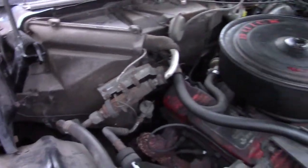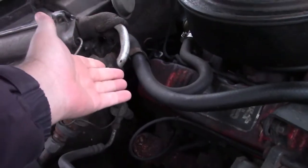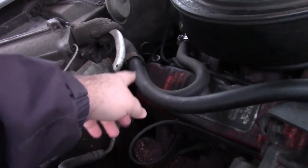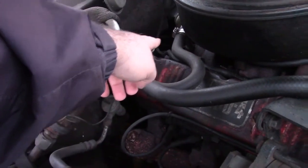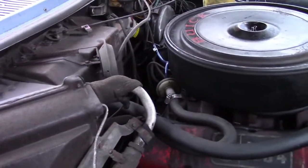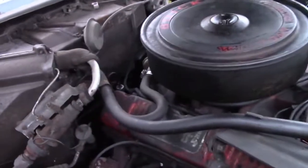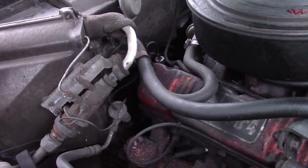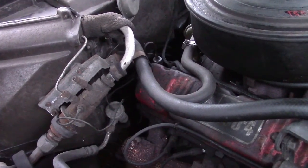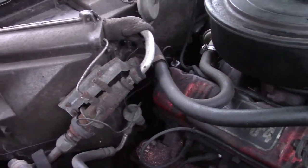to bring her in. Now, I could be cheap about it and bypass the heater core by taking these hoses off. I could actually take this one off and put it to the heater control valve, with my vacuum line using the surgical tubing, which is working great. And that would bypass it, and that way it wouldn't leak. But you know, there are some days in the winter where it's nice to be able to drive it when there's no snow on the ground.